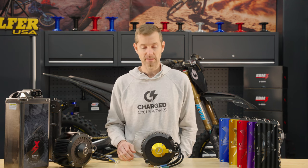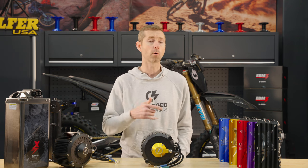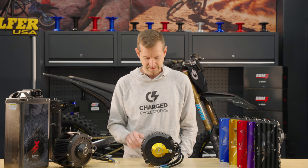Now for the big brother — the XUB80 Ultra B motor that I happen to be racing. It features a larger 80-millimeter stator, peaks at 40 kilowatts, revs up to 12,000 RPMs, and can handle the heat whether you're running a 72-volt or 80-volt battery. You can push these motors way harder and way faster for longer because they handle the heat. The Light B motor produces 64 newton meters of torque at 1,000 phase amps — that's with the new version 2.